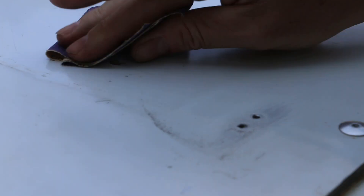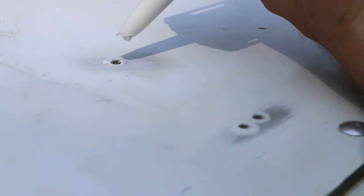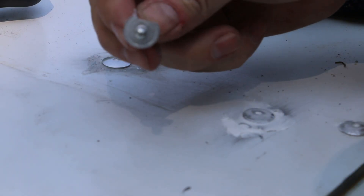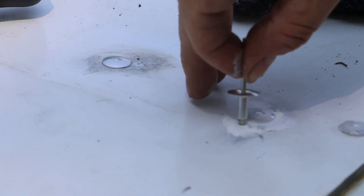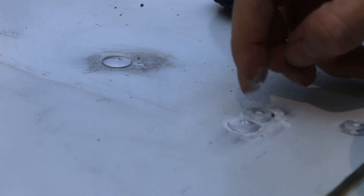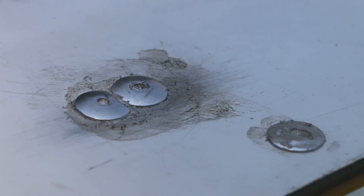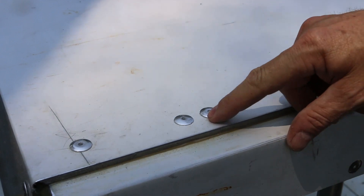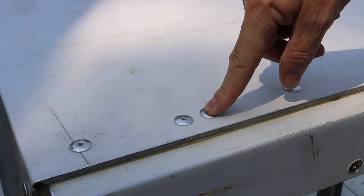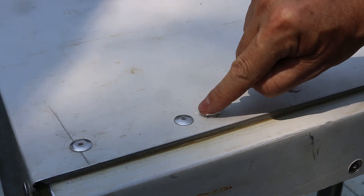Time to patch these holes. I'm going to sand them down to clean them up a little bit, then drill them out, pop in a little sealant, and then finish it off with a rivet. I modified this rivet to get close enough to this one and still get flush. While I'm at it, I'm going to fill the little holes in the top of these rivets with sealant as well — I'm not 100% sure these are waterproof and there's water sitting in these holes, so I'm going to make sure the water can't get inside. This is waterproof exterior sealant, of course.